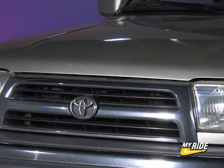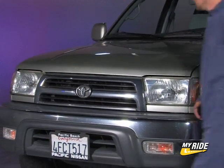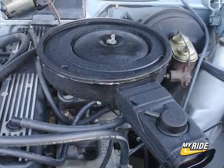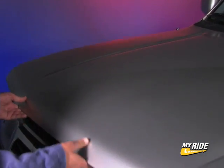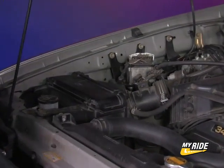Step 2: Locate your air filter. Open your hood, and your filter is usually found on top of the engine. On old carburetor engines, there will be a big round piece of metal on top of the engine — a little bigger than a frisbee or a medium pizza. On newer cars that use fuel injectors, the filter will be in a rectangular housing located off to the side of the engine.